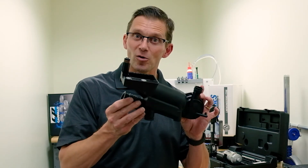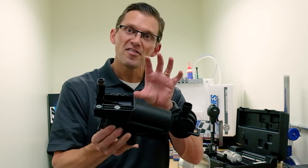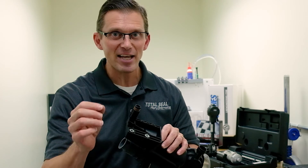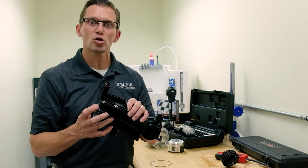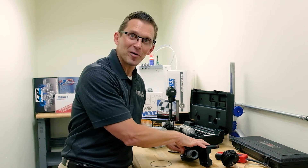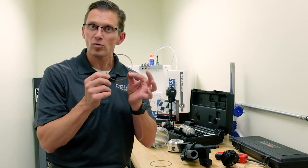This is an air-oil separator. It separates the air and the oil that's whipped up inside the crankcase, but it also creates a vacuum in the crankcase. By applying vacuum to the crankcase, which helps draw the oil and air into the air-oil separator, I can now lower the tension in the oil ring.